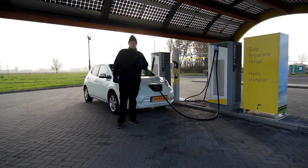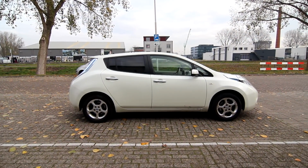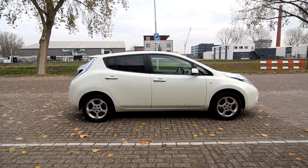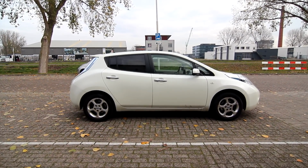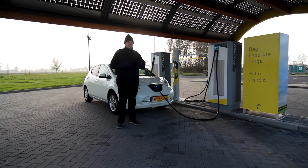Two reasons for that. First of all, if we buy these springs in bulk, we would actually be able to use them on both the smaller and the larger battery pack. The larger battery pack would sit like a centimeter lower. The smaller battery pack would sit a centimeter higher than normal. But both would have like massively improved handling.